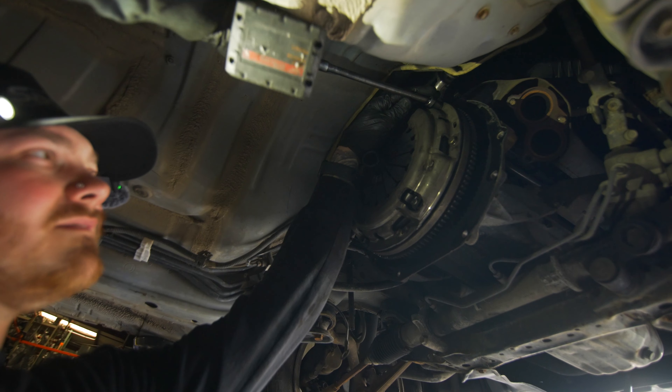I'm putting some grease on this and then going to slide in the trans and grease up the input shaft on that side. I like to grease all contact points — wherever there's going to be a lot of friction, I like to grease it.